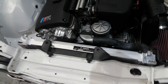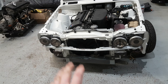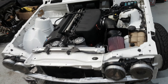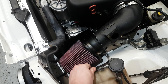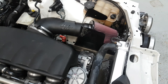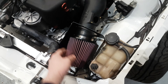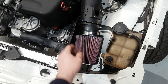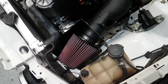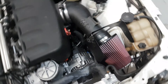He's done a very nice job of that on the front there. That will be finished probably Monday afternoon — the oil cooler mounts will be done, but the fan, radiator and power steering rad are fully mounted. He's also been working on the air dam to keep the air filter nice and cool, so that keeps all the hot air away from the air filter and we're sucking cold air. That's been modified — it was supplied to fit onto an E46 M3 S54, and he's been modifying it all to fit into an E30 chassis with an E30 expansion tank. He's going to mount it on the side where the original cruise control would be.